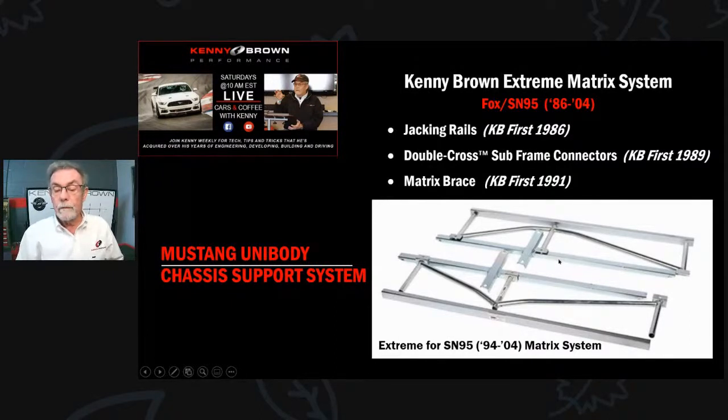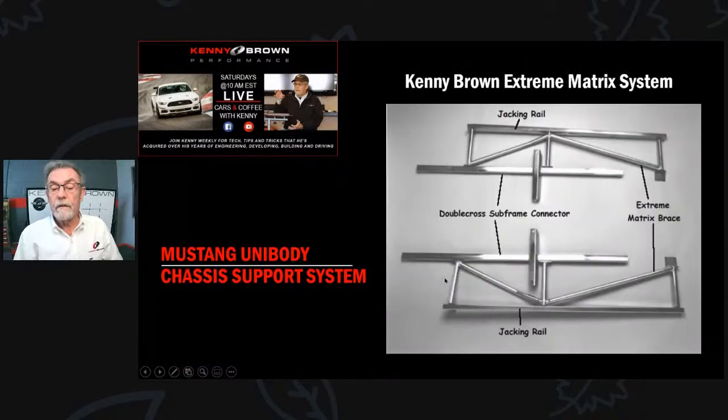And then a little later on, I wanted to add even more strength. So we had the matrix brace, which is pretty unique. A lot of people have copied our jacking rail. A lot of people have copied the double cross subframe connectors. Nobody's really copied the matrix brace so far, which I don't understand, because that's probably the most important part. But by adding the matrix brace here in the middle, you can see that we add 4 full triangulations per side. And triangles are the strongest engineering structure.